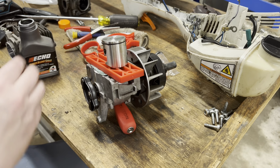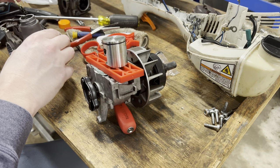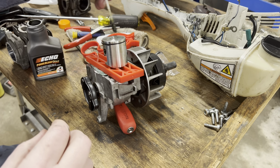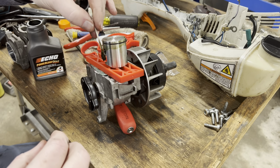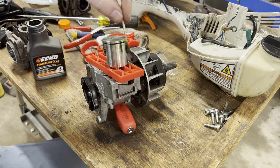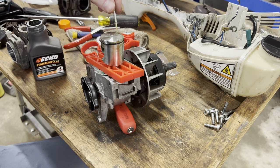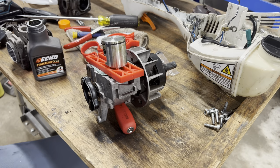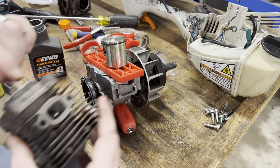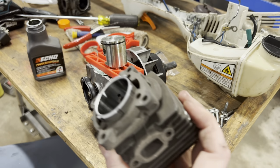Didn't miss anything. What I'm checking on now is adding oil, two-stroke fuel to the piston and the ring, and trying to get everything just really lubed up well. I checked, and this is cotton, and it's going to tell me if I have any sharp edges that I might need to gently file down and smooth off. And so far, nothing. Absolutely nothing. Now I'm going to do the cylinder head here. I'll smooth in there as well.